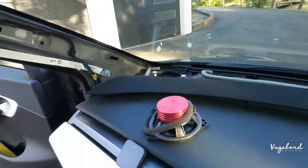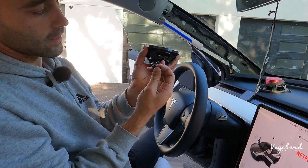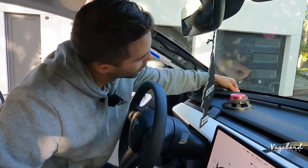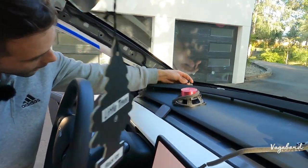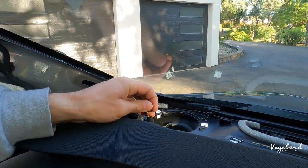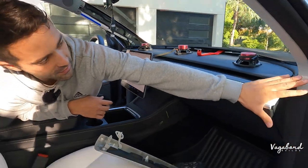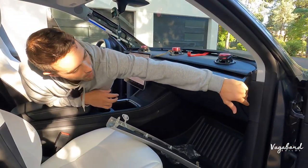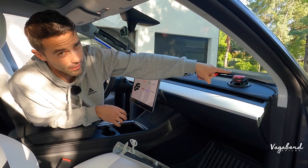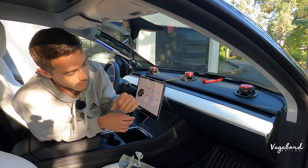So first speaker is removed. You've got three Torx 20 screws and the plug there. In order to remove that plug, you have a little tongue on the harness side — push that tongue up and then slide it out. Now what we're going to do is remove the panels on this side — the panels and the A-pillar panel — so we can completely remove that full cover because we can't get to that passenger side unless we remove this side too. Now let's do the same exact steps as we did on the driver side.